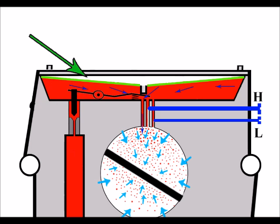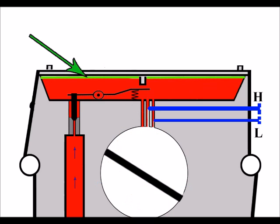It's moving nice and freely, and it's operating at a good distance, making sure that that valve's opening each time the gasket lowers, which of course, as we've mentioned, ensures that there's plenty fuel supply here for the main jets in order to put the fuel into the inlet. Now, sometimes these gaskets can become less flexible and more rigid. And that's normally due to age or the gasket being made of inferior material, so non-genuine material products.